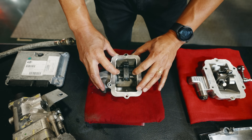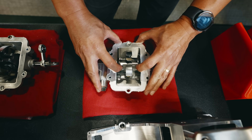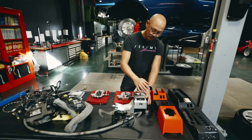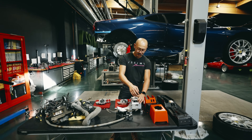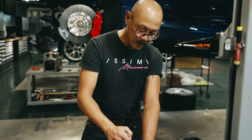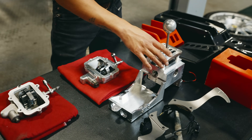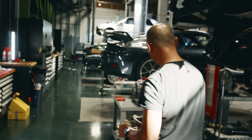You can see there's a lot of action and a lot of shifts back there. You can feel it a tiny bit on this, but not enough to return the shifter. The next concern was the grinding of the gears in between, and as much as we tried to adjust the shift cables, we could not dial it in. We'd be able to get 1st and 2nd great, or 1st and 3rd great, but then all the other ones would be affected with every little adjustment we did. So then we decided to crack into the gearbox and see if we had any particles in there that caused them.